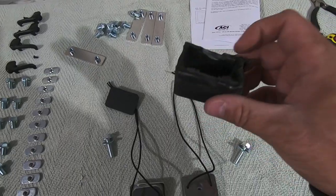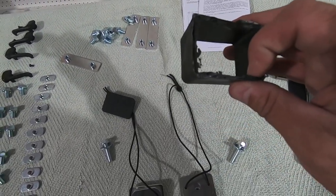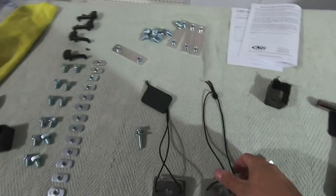In the rear, since you already have a hole in there, you want to cut out that long throat, I guess, or that long sleeve of plastic that comes out of the hole. So just cut that guy and then run a file just to make sure everything's smooth. And like I said, it doesn't need to be super pretty because that bracket is ultimately going to cover up everything here. So let's go ahead and get these guys ready to go.